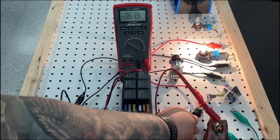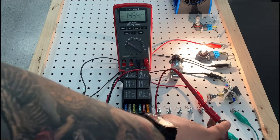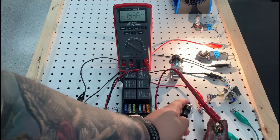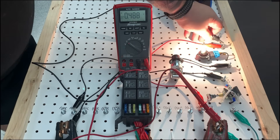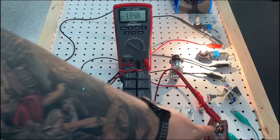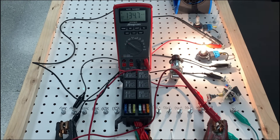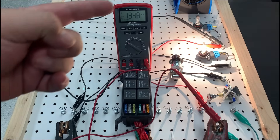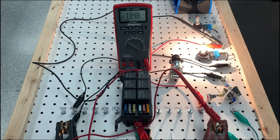From there I'm going to go to the output side of my relay. Because of the contacts we have a little bit of voltage drop — 62 millivolts of loss from our battery reference to my output side of the relay. My next test point is straight at the headlight, and now my meter is showing 134 millivolts. That means from the battery all the way through the circuit ending up at the bulb we're losing 134 millivolts. On the power side, acceptable voltage drop could be upwards of 300 millivolts, so this is a normal reading.